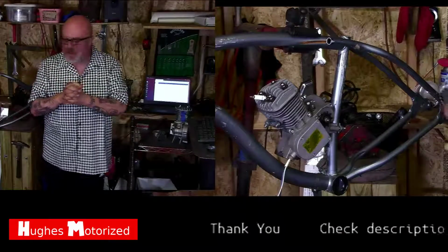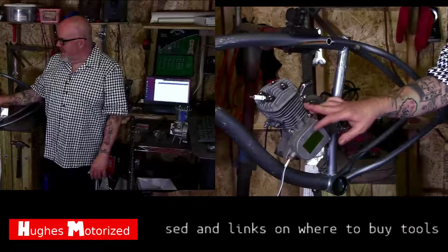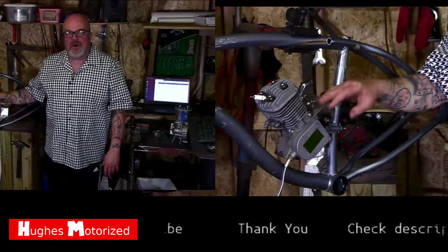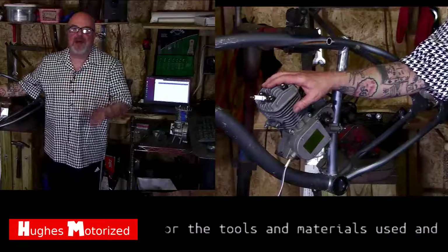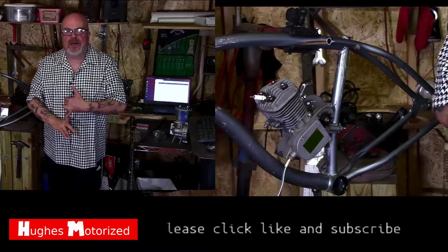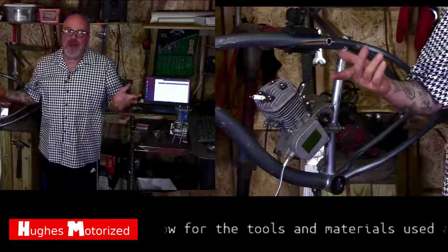We got a lot of things going on here. I'm going to kind of get away from doing the 2-stroke kits, and I want to focus on 4 strokes. These guys here are getting to be cheaper made every day. They're not as quality as they used to be. The chrome bore inside of the motor doesn't last as long as it used to. So I'm getting tired of these things. I see people have a lot of problems with them. Why not spend $100, $200 more on a kit and get something that, one, you're not going to have to be working on all the time, and something that's going to last a lot longer. So that's my 2 cents on it. But these guys are fun to play with. They look cool. So yeah, we're still going to play with them.